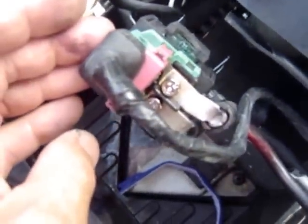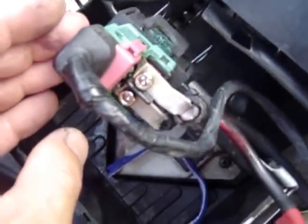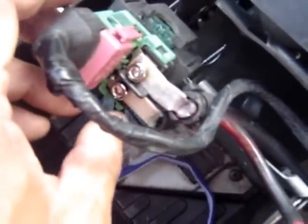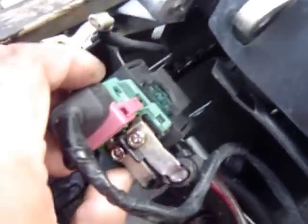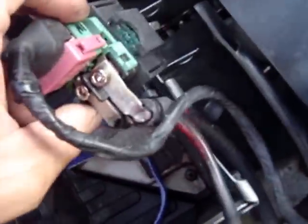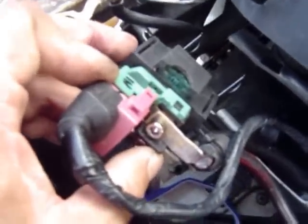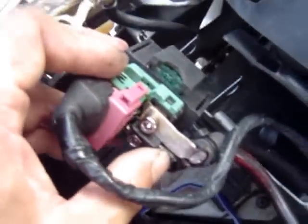That will shut off the bike — that will give you a scare. Also this starter relay — this is my fourth starter relay on that bike. Aftermarket starter relays are pretty good, some of them are for the VFR, but don't listen to claims of heavy duty sets. This right here is designed to have a heat shield all around it. If you do not get a starter relay that fits into that heat shield your starter relay will die — it will melt. I went back to an OEM and I have never had any problems since.